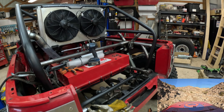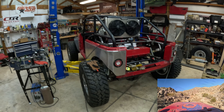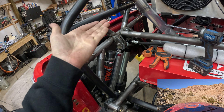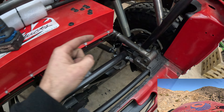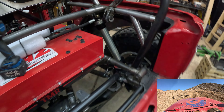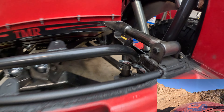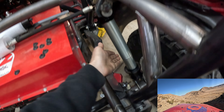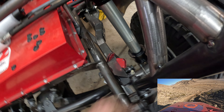In the last video with the suspension I was talking about setting limit straps - the last thing to do is set our hydraulic bump stops, which is also going to save the shock. At the end of the stroke on a bypass shock there's what they call a bump zone where it gets really stiff, almost like an internal bump stop in your bypass shock, but we still need a set of bump stops - hydraulic preferred - mostly to help our bypass live a little bit longer and cushion a lot more. I have it mocked up on the inside of the frame. Traditionally it's better to mount it towards the end of the tire, but with our dual shocks outboard, the frame gets really tight and we'd have to notch into it, which I don't want to do for strength reasons.